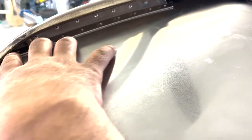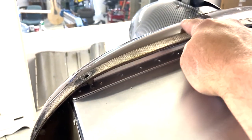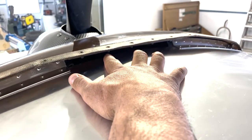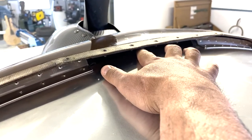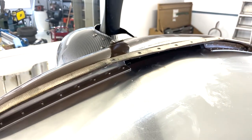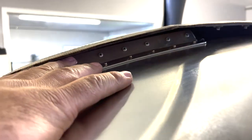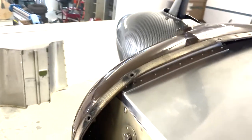Did some more test fitting, then came in and put these flanges down here — they're bent at 45 degrees, and I had to stretch out that flange to match this radius. There's also another flange bent down up here, underneath this part of the cowling, and it's bolted up there. So I have clearance under everything underneath the motor. These flanges have a little bit of rubber pushed down by the cowling to help direct all the air in.